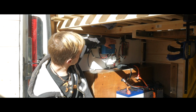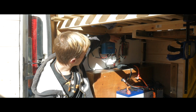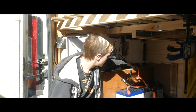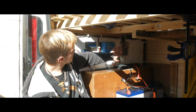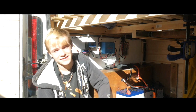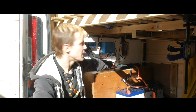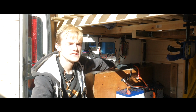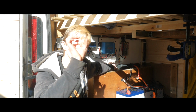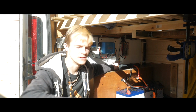But yeah, so I'm really pleased. This Victron Orion-Tr works really well now, because I had a small little issue with it, but it was the starter battery. The bus bars, very pleased with them, and very pleased with all the cabling. Stripped 16 cables and then the 2 inputs, so that's 18. It was ridiculous how many cables I was doing last night. And these little pipe clips, if you need something to tie down your cables, definitely use these. I think mine is the 15mm for the PVC piping. I think you can get them in 22 as well.